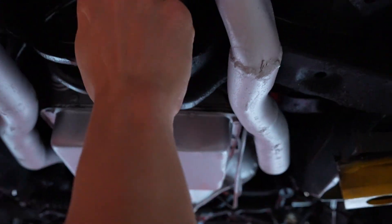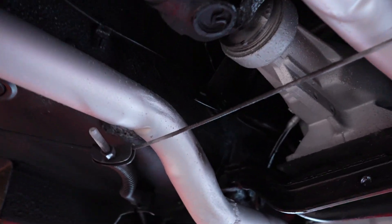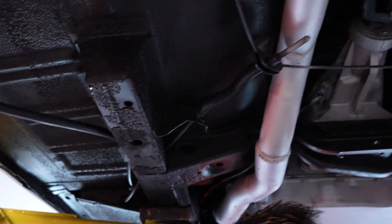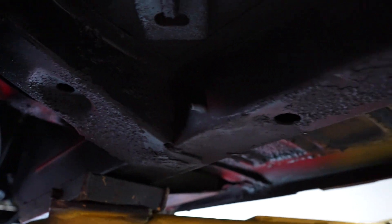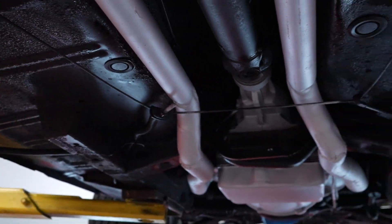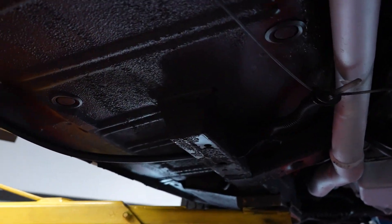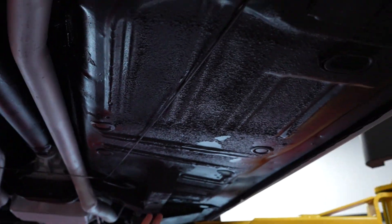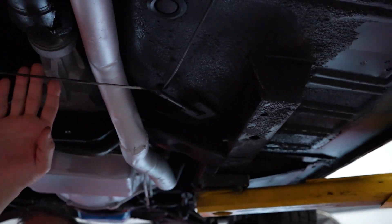The tail shaft seal looks dry. The frame rails here are torque boxes — looks like somebody might have put a tow hook there one time and ripped a little bit of the torque box, but other than that we look to be in good shape. The floor pans in the car are fantastic. We don't have any restoration history on the car; however, they do look to be all one solid piece all the way from the back to the front on both driver and passenger side. The e-brake is hooked up and that works.